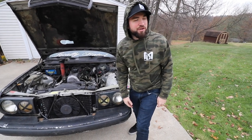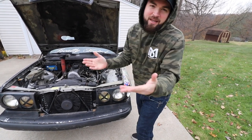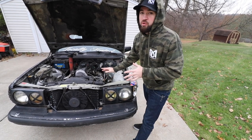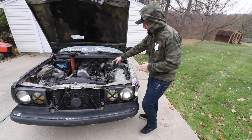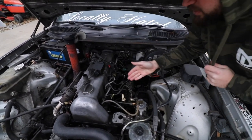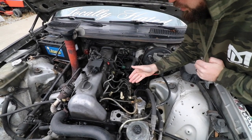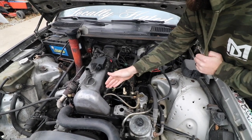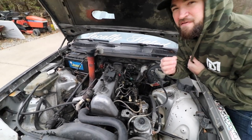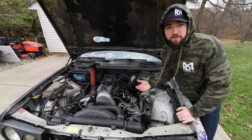Alright, we made it back to the garage. Someone's cutting the grass and it's super cold in the middle of winter, but hey, you do what you gotta do. So what we're after is lubing the mechanical injection pump right here. For all you 12-valve guys, this is essentially the same kind of system — mechanical fuel pump, fuel lines, and injectors. The whole premise of the premix in the fuel is to lube your fuel system.